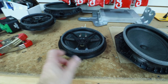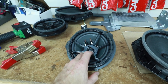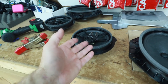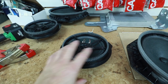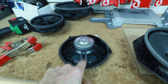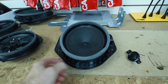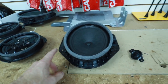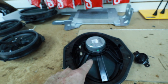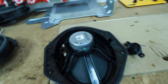This is the speaker that comes out of the rear. It's a 6.5-inch with a funky mount — three holes on it — and it's got a tweeter. This is unique because very rarely do we take out speakers and it actually be a coaxial like this. Here's your magnet so you can get an idea of its size. This is made out of plastic. This is what comes in the front door — it's kind of like a 6x9 shape in the center but with an odd mount. Two screws here, two screws here. On the back side though is a tiny magnet — not neodymium or anything like that, just a standard tiny magnet.